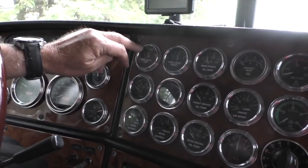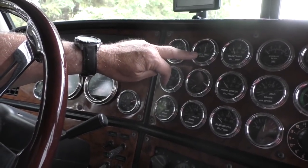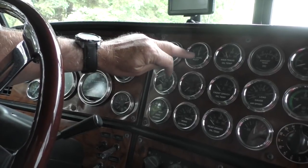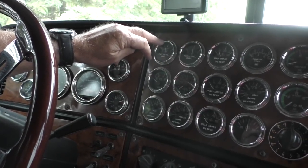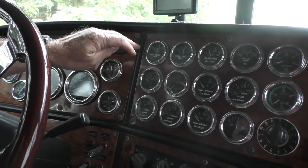If I'm trying to run really heavy — and I don't like to do that — what I can actually do is fill one tank and shut the other tank off, so it only draws from one tank. That allows me to load a minimum of fuel, keep my weight down, and still monitor my fuel progress and burn without running the thing out of fuel. Once these things suck dry they don't like to go again — they're hard to prime. You've got to be careful never to run them out of fuel.